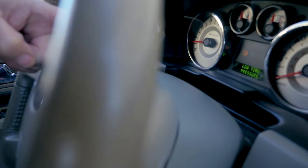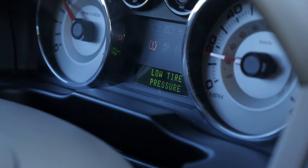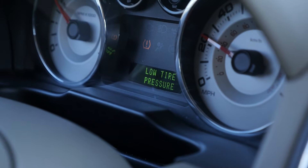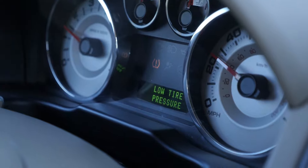We've done everything we're supposed to do, but there's one problem: the low tire pressure indicator is still on. What's up with that? We have one more step — you actually need to reset the onboard computer that's part of the TPMS. To do that, we need to go for a drive: drive over 20 miles per hour for several minutes, and then the message will clear and you're ready to go. We're out now, exceeding 20 miles per hour and driving along, but we still see the message displayed — it has not reset yet.